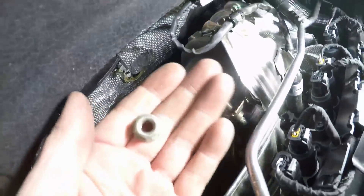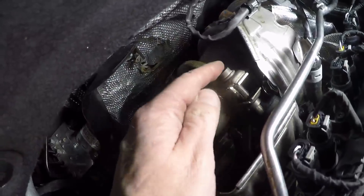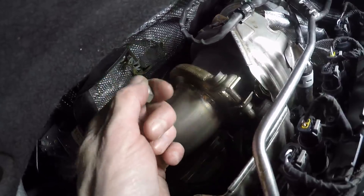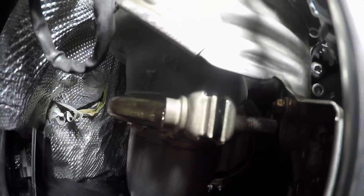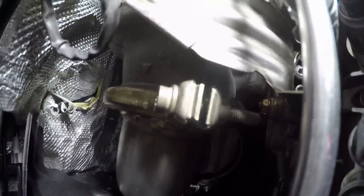Your clamp is not going to be nearly as tight, so do not tighten it down trying to get it to touch - it's not going to happen. Don't forget the trick I mentioned in the last video: these things always shake loose. Go check yours in the car - I bet one out of ten people you can turn it with your finger. Put a lock nut, a 13, on the end of your threads back there to ensure it doesn't back out. Once I get my tightness I lock it down - it's not coming loose. I ended up almost touching but it's so tight now I'd snap it if I go any tighter, so there's about a quarter-inch gap.